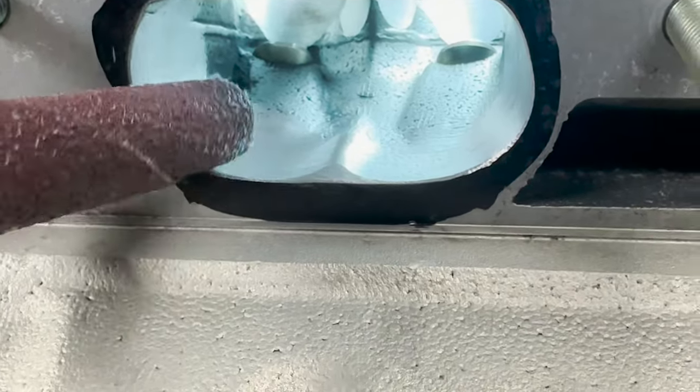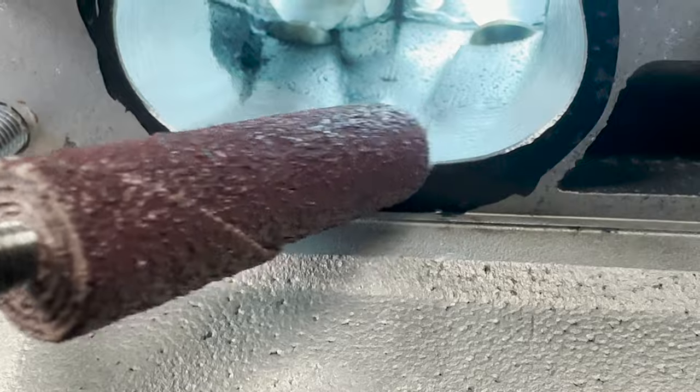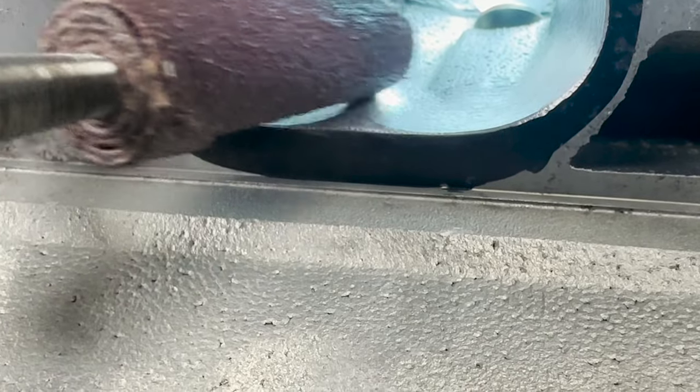One thing I want to discuss was sanding up to this point here. Now we have what seems like a little thin spot, and what you don't want to do, guys, is go like this. Going like this is going to create a hump, which means that this and this side will be round, and we want it to be straight. We want it to be straight all across, because that's how the gasket is, and the intake manifold, everything. So we don't want a big hump there. To accomplish that, I'll sand up here first, just the top, and then I sand up to this radius here and this radius here from this side. And then you just lightly go over it to blend. What you don't want to do is go like this, because you're going to create a hump.